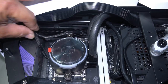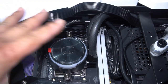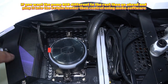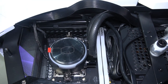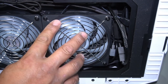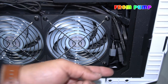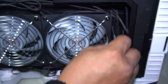The other five-volt three-pin ARGB - what I'm going to do is connect it to the splitter for the fans at the bottom so it syncs with all the RGBs. If I plug it straight into the motherboard five-volt three-pin, it's going to be a separate color to the rest, and I want to be able to control it using the button on the case. So I'm going to route the cable through this gap which allows cables to pass through at the bottom, and plug it off one of the splitters for the ARGB fans. Underneath the case is where your splitters are for each fan. I've just plugged in the pump's sleeve cable with one of the splitters that come off the ARGB fans and I'll hide the other five-volt three-pin under here to keep it all nice and neat. This button will allow us to change the RGB colors.